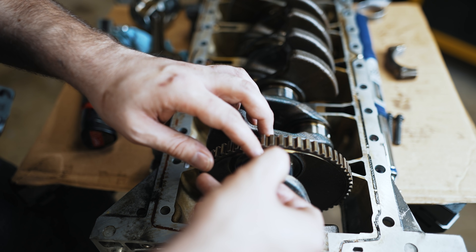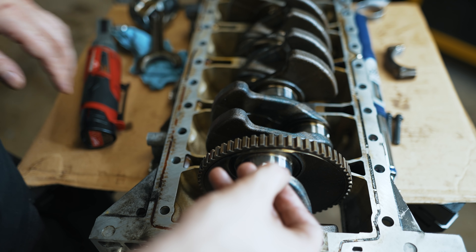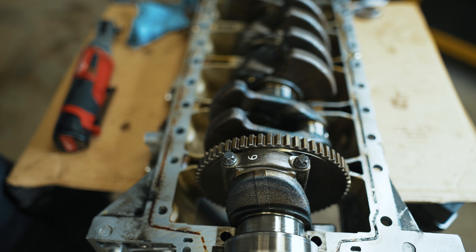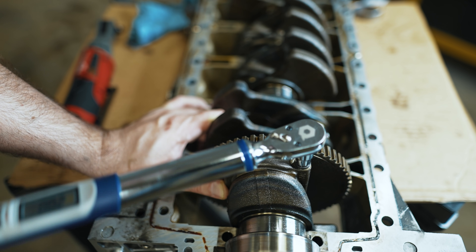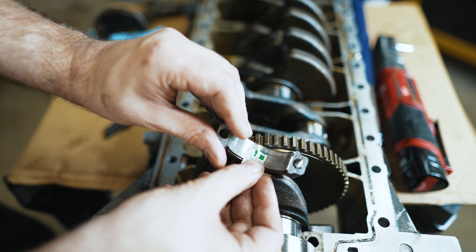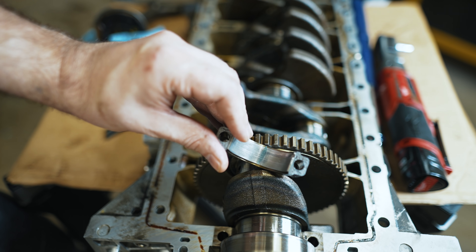To be honest, not what I was expecting. I'm the same or even a little bit wider than I was with the King bearings on my stock bearings. Now I'm a little concerned. I'm going to try going to 70 degrees once instead of twice to see what it does to the clearances — and it didn't really change much, still up there, closer to like a thou. Something's not adding up to me; I'm going to look into this a little bit.